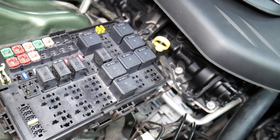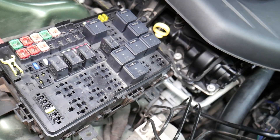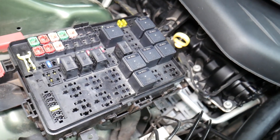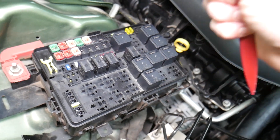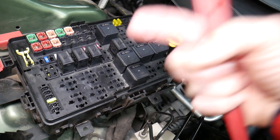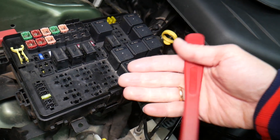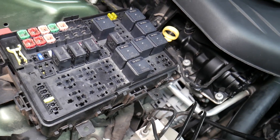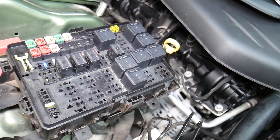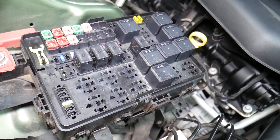For instance, when working on airbag fuses or anything like that, you need to wait at least one hour after disconnecting the car battery. And if you're not qualified and certified to work on the airbag system, I would never recommend doing that. Also, a common mistake people make when disconnecting the car battery: it's important to know which terminal you disconnect and reconnect first. If you do it the wrong way, you can burn electronics modules. We know because we burned a traction control module on a BMW that cost $2,000. We'll put a link in the description below on which battery terminal to disconnect first.